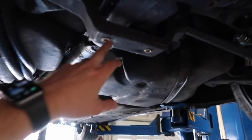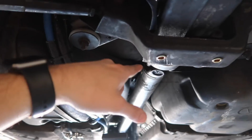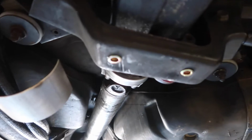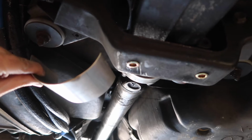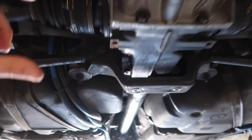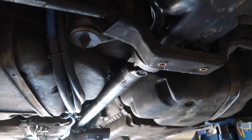What I'm gonna do is go ahead and throw it up there. What we've done is we put a rib nut here, 2 rib nuts here. We're gonna make a plate that goes across, and then kind of like a hanger, but it's basically gonna be an exhaust piece. This piece right here. We're gonna create a plate that goes here, weld this to that plate, and it's gonna be like a little cradle basically for the exhaust, so that way it makes pulling the exhaust painless. And then of course on each side of the exhaust we're gonna have a clamp to hold it in place and keep it from vibrating.